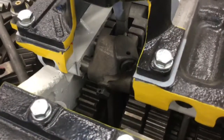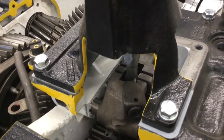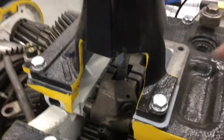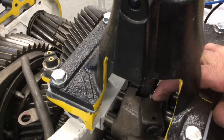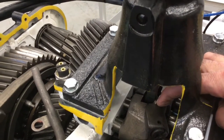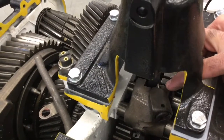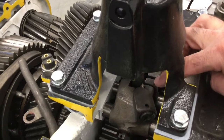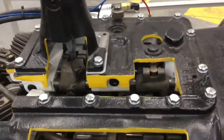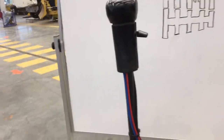This is our shifter — it has one finger that fits into all of those rails. When you slide the shifter from side to side, it moves between all three of them. The closest position has a detent that makes it harder to go into that side, which would be first or reverse, so you don't accidentally hit reverse while going down the road. This is a five-speed main box — the center position is second and third, and the last one is fourth and fifth.